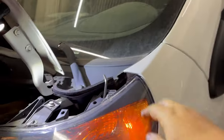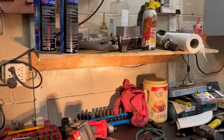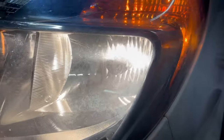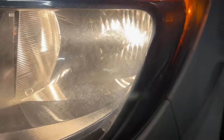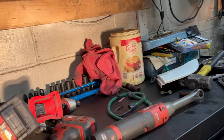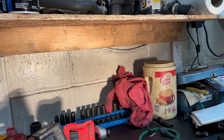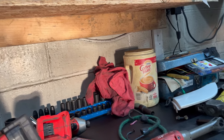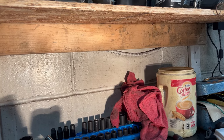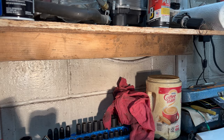This is the van with the light on. As you can see, I have my tool here and on the wall we're pointing roughly right in the middle of that wooden beam. As I turn this — let's go clockwise and see what she does. You should be able to see this thing move. Both the high beam and the low beam move together. As I'm tightening this, it should either come down or go up. I can see the shadow going up — so clockwise is up.